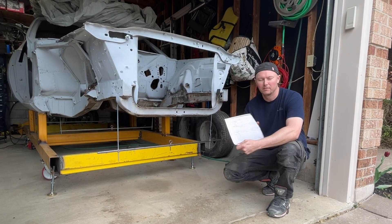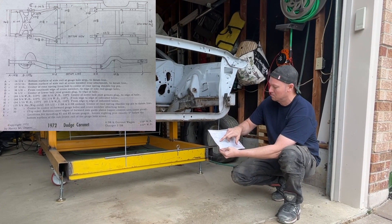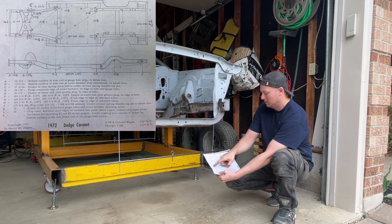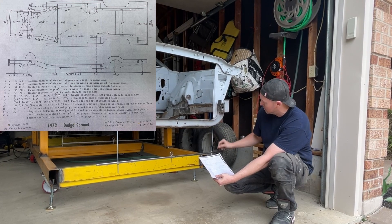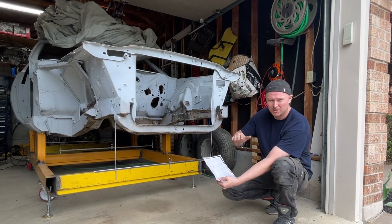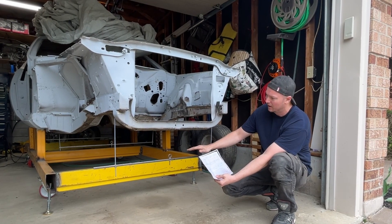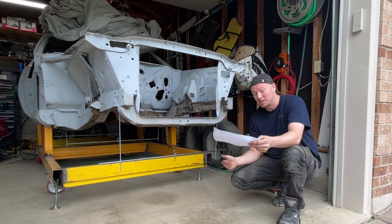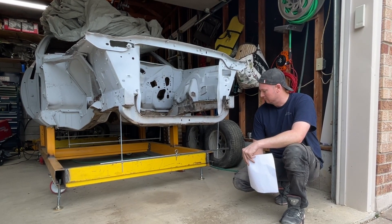We have a copy of our frame dimensions here. This line is our datum gauge or datum line, and you can see there are measurements from the bottom of the frame to this datum line. We've made gauges referenced by these holes and markings — this piece is our actual datum line. When we put all the rods into the frame rail holes and gauge holes, if the frame has a twist, or a rail is low or high in one corner, it'll show up. When you look down the line, you should see just one bar — if you see more than one, you know a section of the vehicle is off. That's what we're trying to determine today and make sure the car is nice and true.